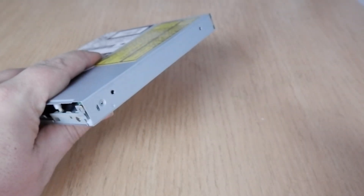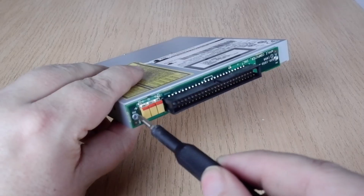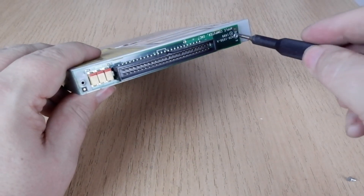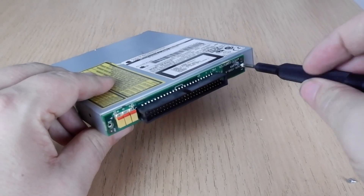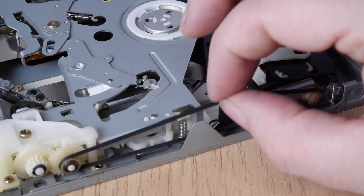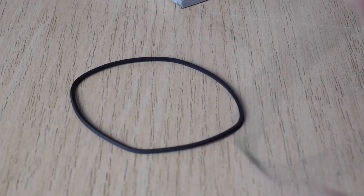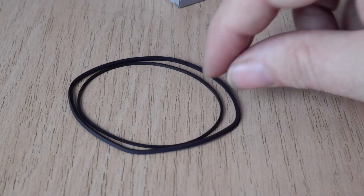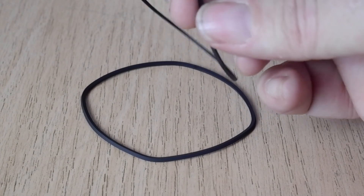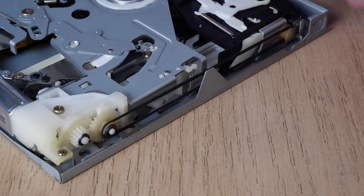We're now almost to the point of opening the case. First, we need to remove two tiny little screws from the side. We also have to take the back I/O ports off, which is simply removing two screws and then pulling the board away from the drive. It's all held in there snugly with a little plug and it's really well designed, as you'd expect from Apple. With the case open, there's our drive and it kind of looks okay but not brilliant. Drive off, you can see it's gone a bit square. Here's a new drive belt — it's actually too thin and smaller, and I'm a bit disappointed, but I feel like I can just push on and hope for the best. Replacing the belt is fairly easy and then it's just reassemble to get the case back together and try out our new and improved DVD drive.